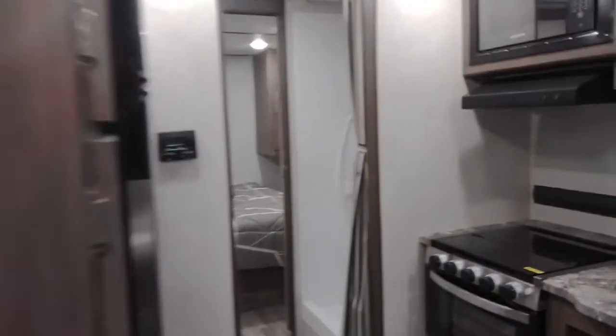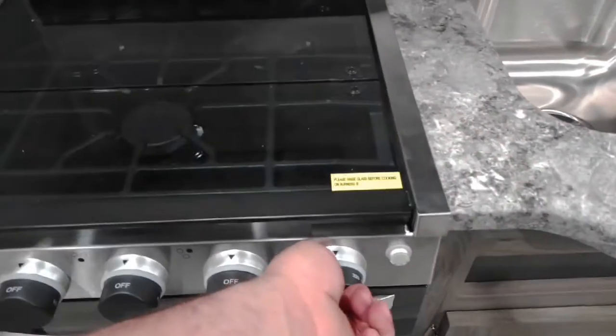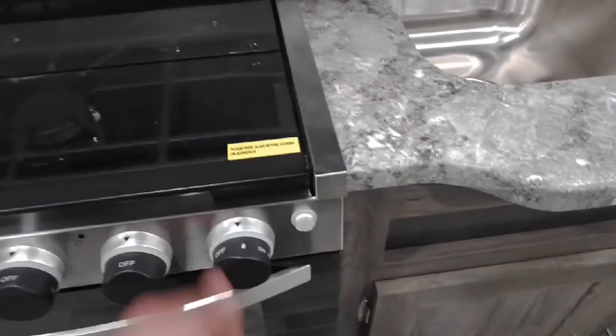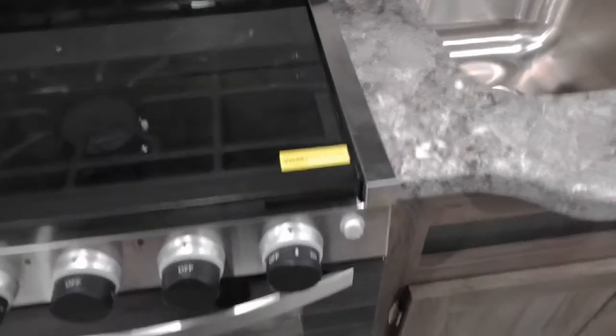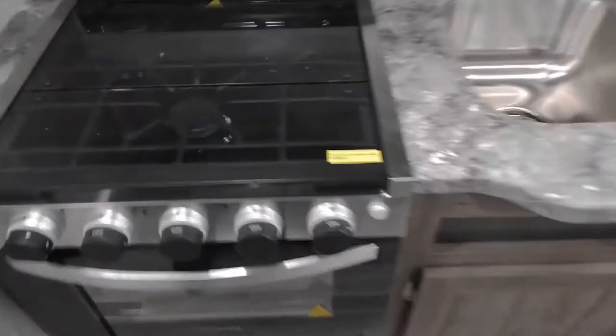This is kind of a different layout — it's kind of cool. Your water heater is actually in that cap right there — there's a couple of screws to take out. Behind this bottom drawer is where you're going to find your water pump. Carbon monoxide and LP detectors are right below it. So for winterizing, that's where you'll have to get to. The stove — sparker for the burners up top. For the oven, you're going to put it to the flame position, push it in, hold it, and then spark it. It normally takes a good minute or so for the gas to get down there, then push in and hold it for about 10 seconds, spark it — it's going to take a few tries. Once the pilot lights, hold it, and it should light. Once it's lit, you can let off and you should be good. If it goes out, you've got to redo everything.